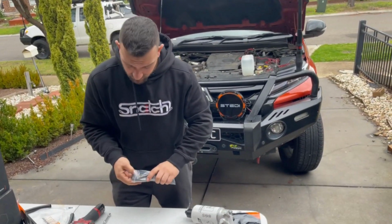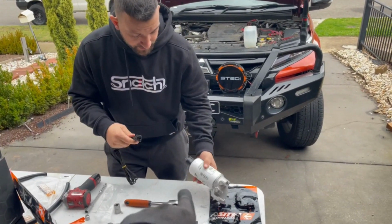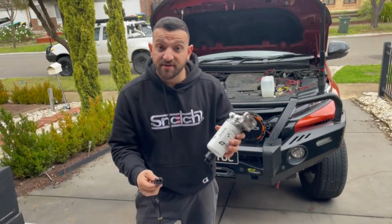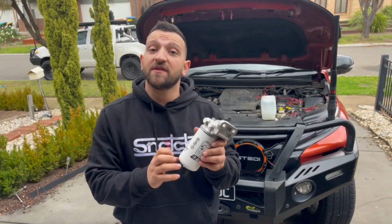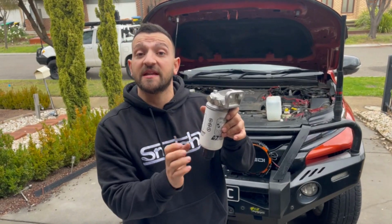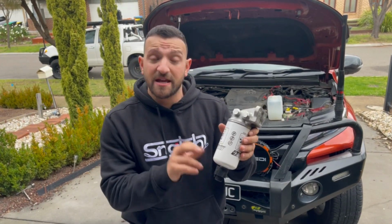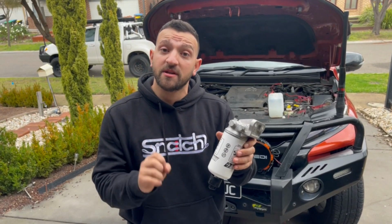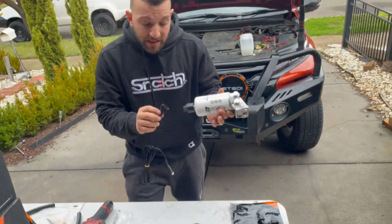Okay, so what does the filter sensor do? The filter sensor itself senses whenever there's water or contamination or anything that's come to the bottom of the filter kit that needs to be removed. So when we release that, it will pour everything out. It has a flashing light inside the cabin and an alarm system there. Beautiful. I'm going to plug this in now.